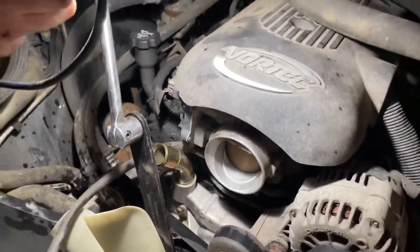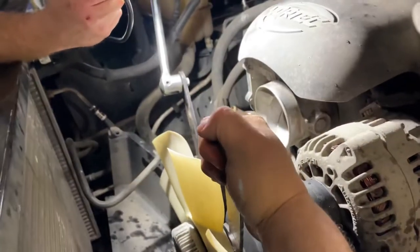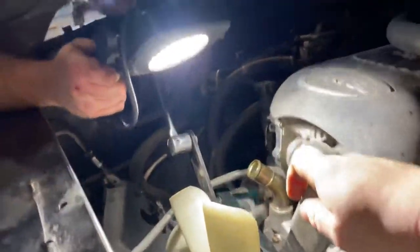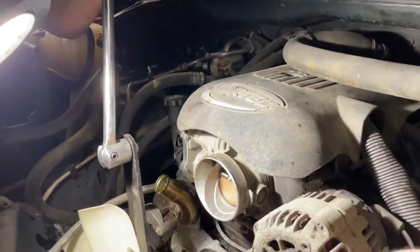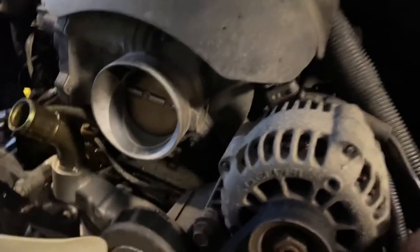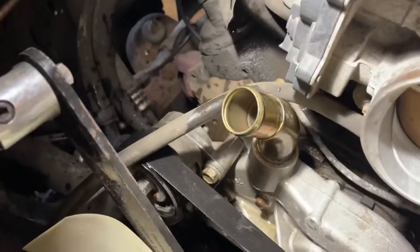If you have two guys it really makes a difference. I'm going to hold the spanner wrench on the water pump and Jamie's going to pull the breaker bar. We need some place to rest the wrench — we'll use the belt here for leverage, though that's not officially recommended. Ready... and we cracked it free, though the spanner wrench slipped off.